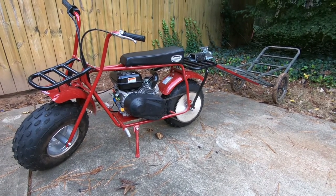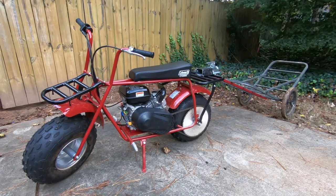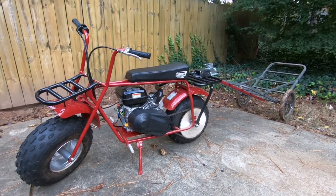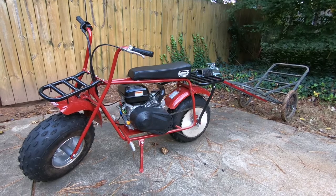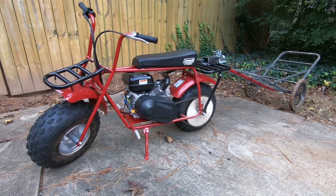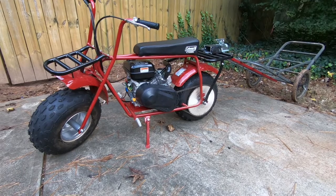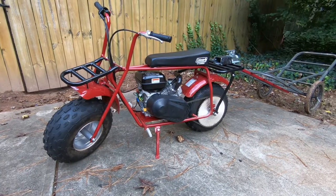When I first bought this thing with the existing engine, it would only do about 19.5 miles an hour with me on it. Now, even with the huge sprocket on the back, that torque converter really helps out and it'll still do about 39 to 39.5 miles an hour — that's what I had it up to. I'm obviously not doing that in the woods or with anything on the back, but it's nice to know I can unhook the trailer and still have a bunch of fun zipping around. The torque converter is really the biggest conversion. Hope you guys enjoyed the video!